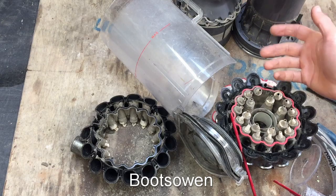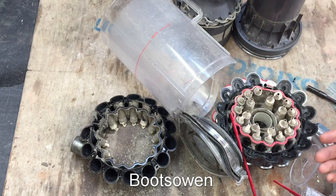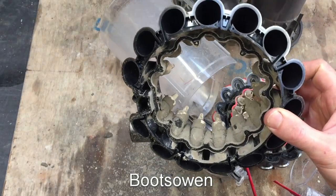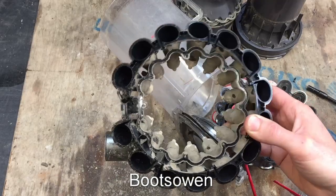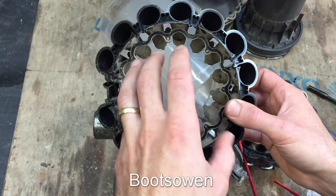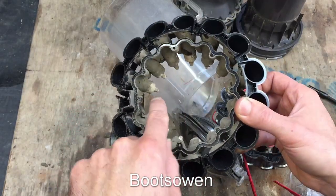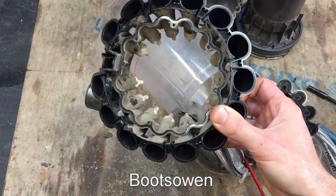Just to recap: if you're going to clean it, clean it with a washing up brush and a sponge in hot soapy water and give it a rinse off. Let it dry completely before you use it - in reality it's easier to make sure it's dry before you put it back together. Everything needs to be dry, otherwise the moment you use it the dust will just stick to it. The dust sticks on from static, but it'll stick on from moisture and will be locked on. Whereas at least with this dry setup, in theory you can tap it and it comes off.